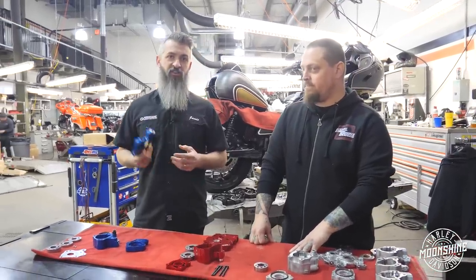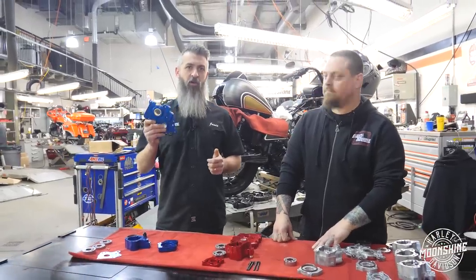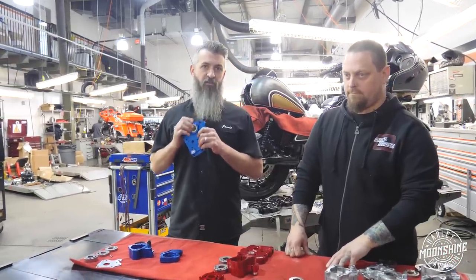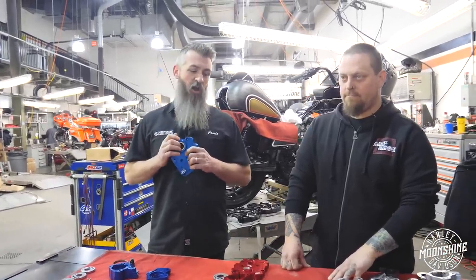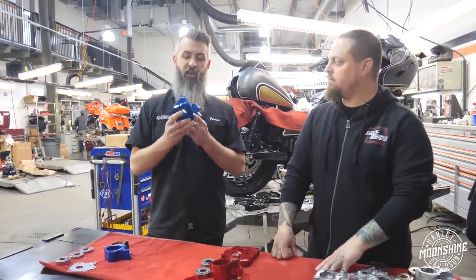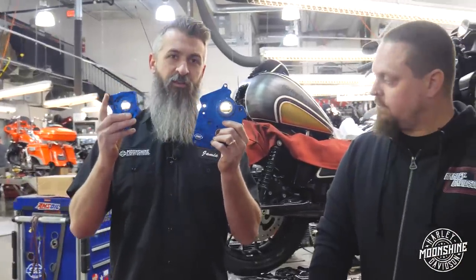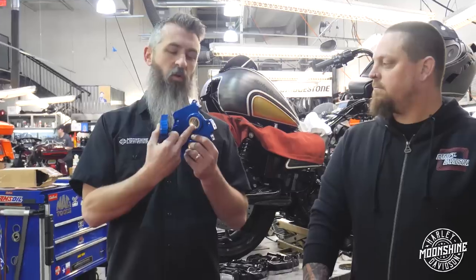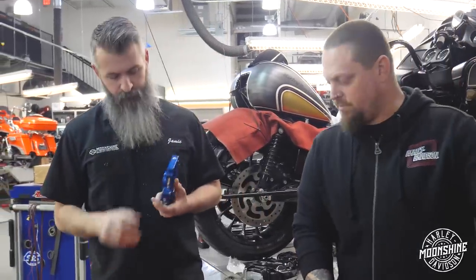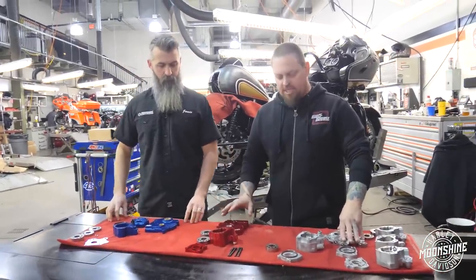So there are specifications — which are 0.005" run out of your pinion side of your flywheel — if you want to install these. If you don't spec out for one of these, you can't put it in. It doesn't fit every single M8. Because there are tolerances for where the pinion side is going to be pushing your gears through the pump and through your cam plate. And if the tolerances are excessive, it will wear and gouge the plate and pump themselves.